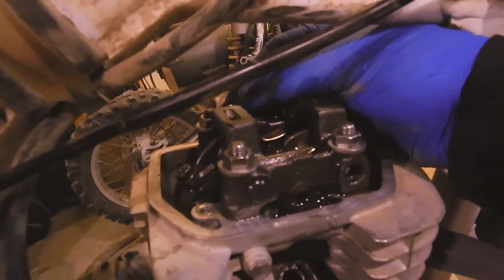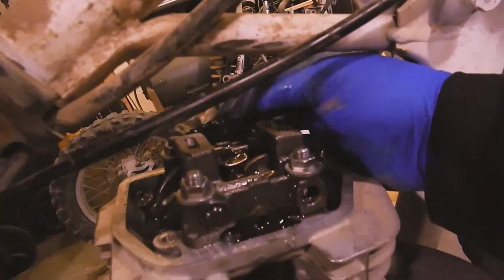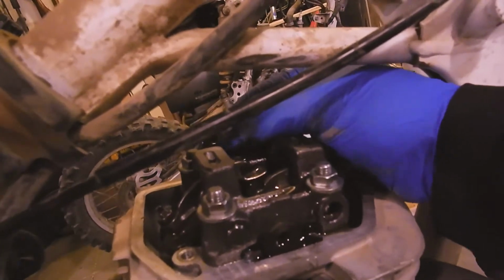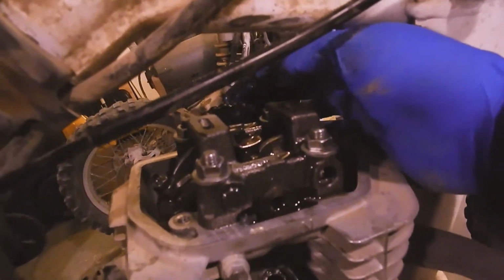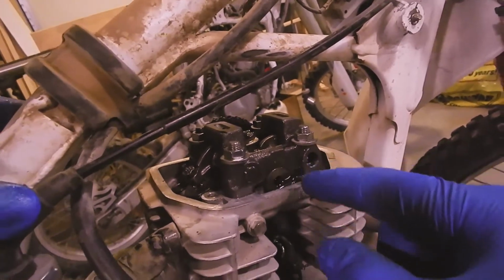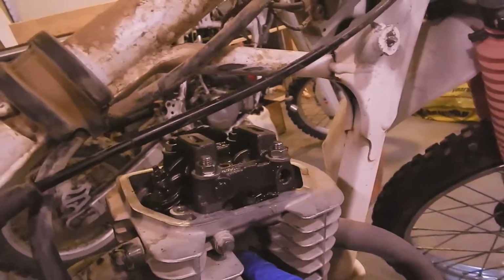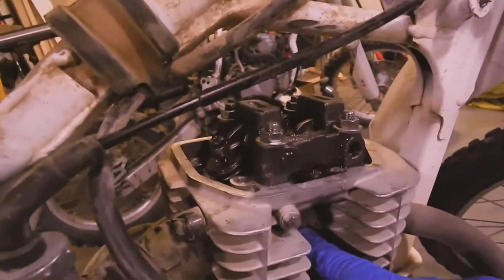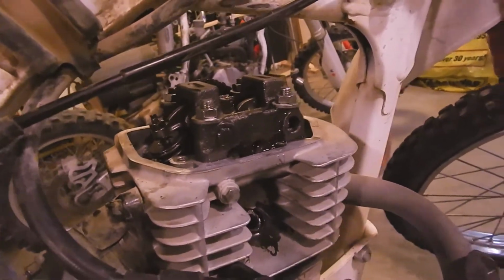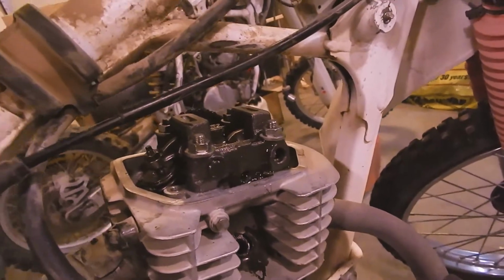But this isn't. Well, now look at that. Look at that. It must have a hydraulic tensioner. The chain is no longer loose. When the oil started coming up into the top end of the motor, it pumped that guy up. And the more I kick it over here, the more compression I get. It was just all dried out. Unbelievable. I've never had anything like that.